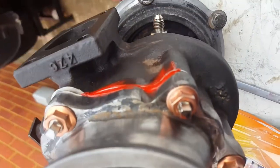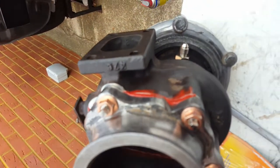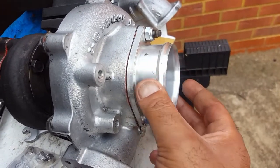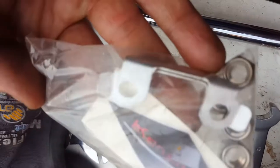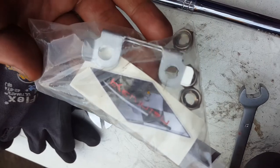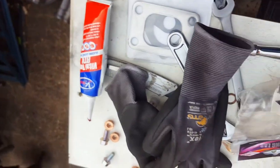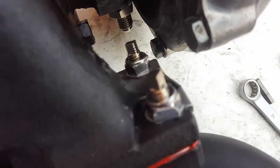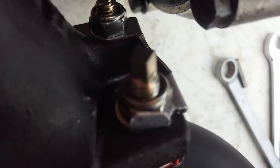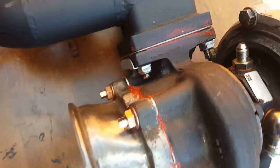That is the v-band adapter on there — and by gosh is it on there. I've tightened those nuts till kingdom come, so hopefully they'll stay there, and I've used some high temp sealant as well. The inlet fitting has been fitted, all nice and solid. I bought a locking tab kit with special nuts, so I'm going to use that and lock it all in position, using the high temp turbo-to-manifold gasket. The lockers are all on — those nuts have little cutting bits in them that actually cut into the stud.